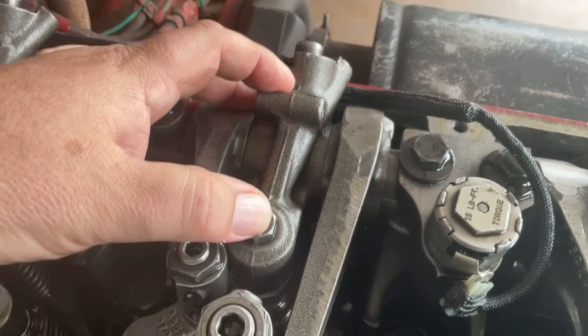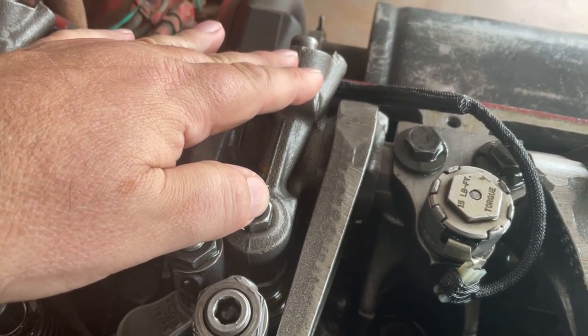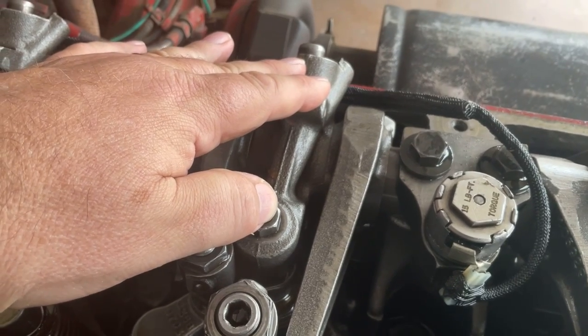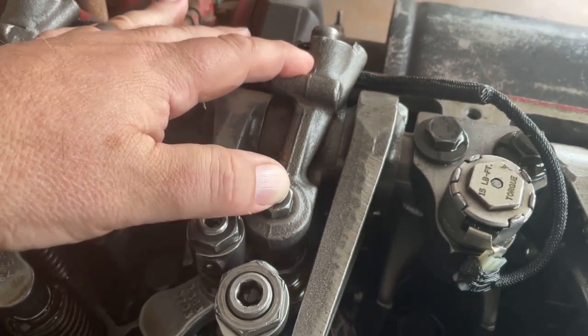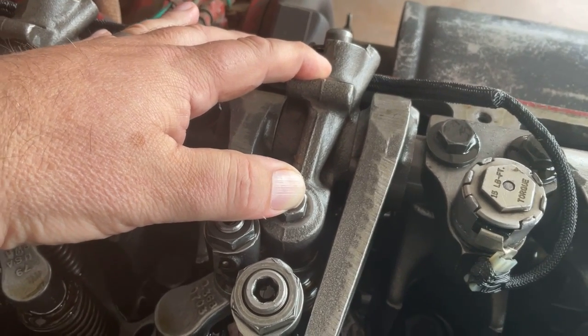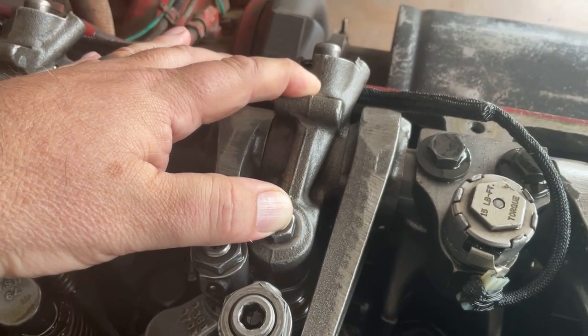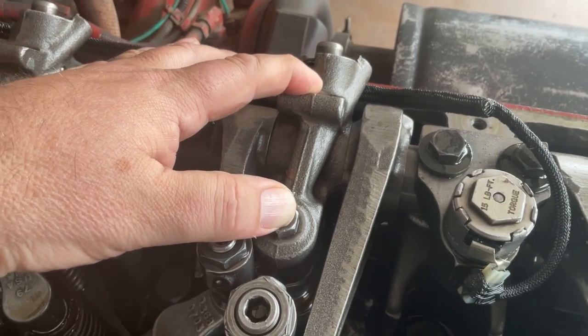So we have this guy here designed so that if you've got your engine brakes on and you're coming down an incline or something and you're trying to slow down, this guy will actually start opening the exhaust valve at the top of the compression stroke, releasing all the compressed air. Without compressed air, you can't ignite fuel, so you're losing power in that cylinder.